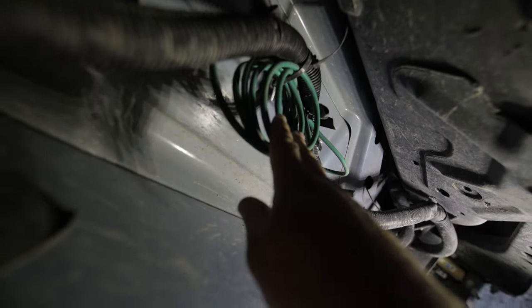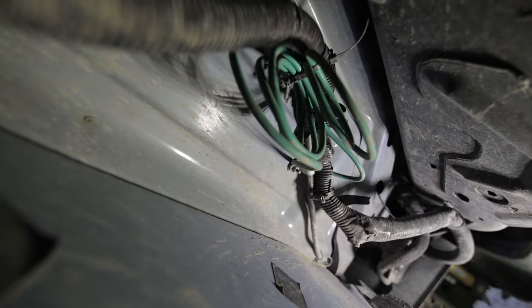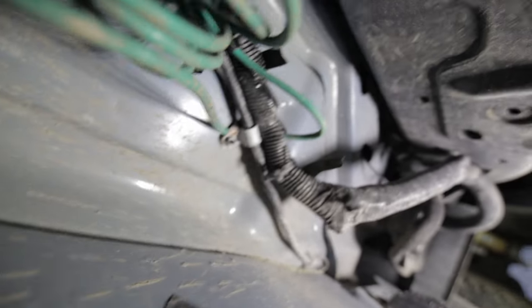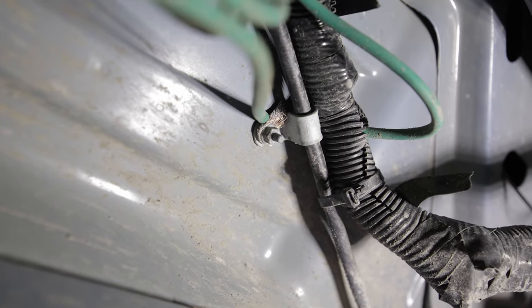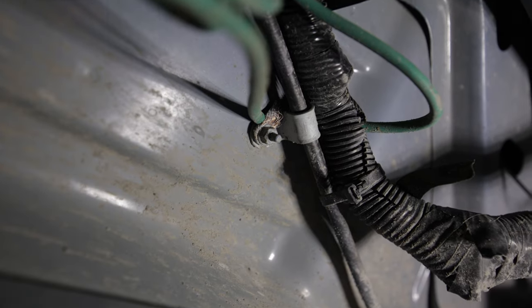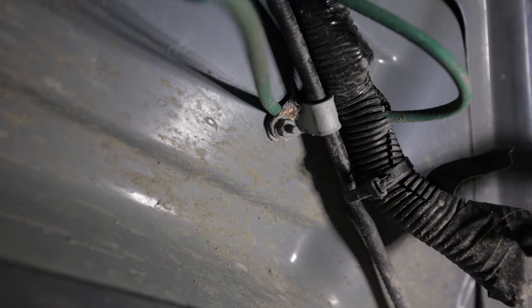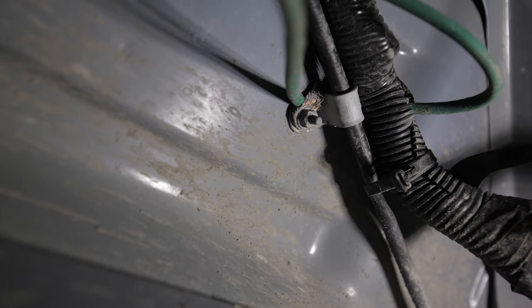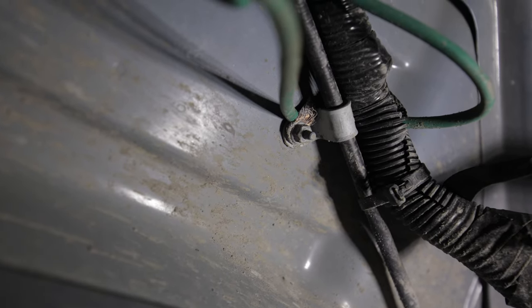Here's my wire — there's the ground wire. The only issue I have with my system is I should have pressed a lug on the end of this little wire and grounded it to the frame properly. What I did was open up a nut and wrap the wire around it. That completes the fault path — when something shorts out, it draws more power and trips the breaker.